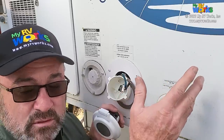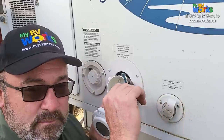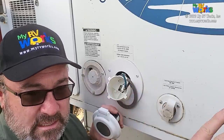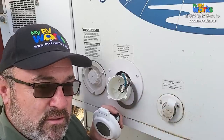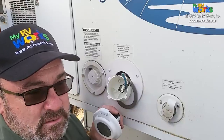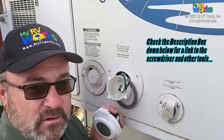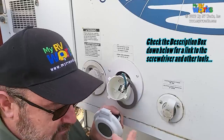That made me think of a tool we're going to be making for you guys, but we'll offer that later. But you would be surprised if your homework assignment was to go into your breaker panel, disconnect everything, and just torque all those screws. You'd be surprised. Where we find the loosest ones are the white neutral wires. Those should be anywhere from 25 to 30 inch pounds. We have a link on our site for a torquing screwdriver, which I've used in a lot of my videos as well.